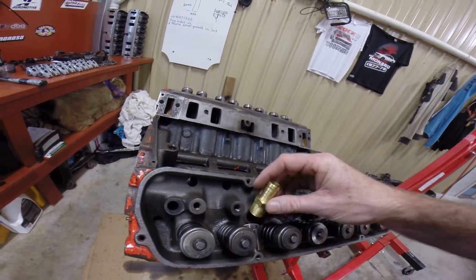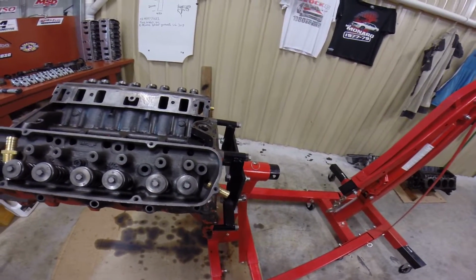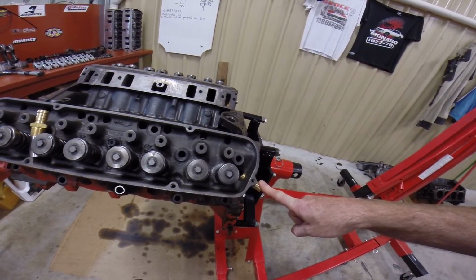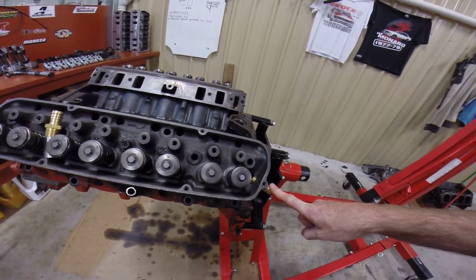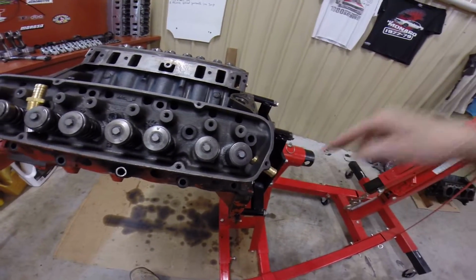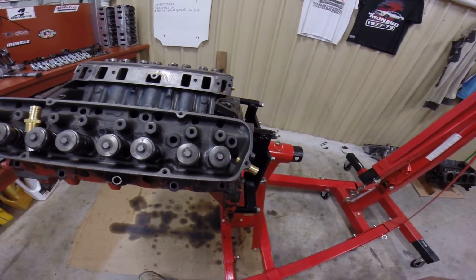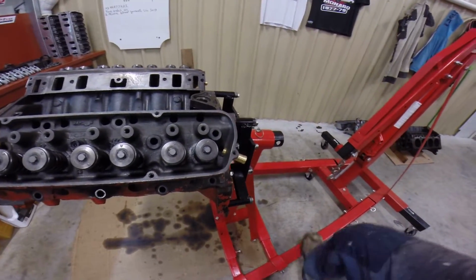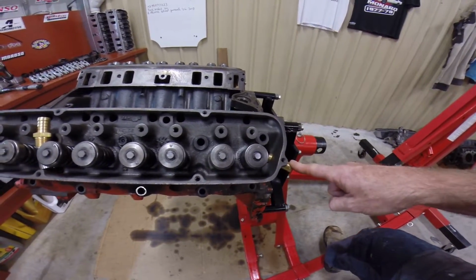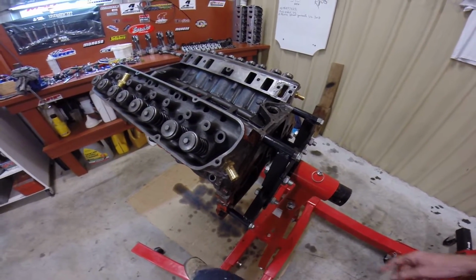Now I was thinking about just doing it gravity style, but I'm not sure if it's actually going to be enough, because if you've got a certain amount of crankcase pressure in the engine, you're not really encouraging the oil to get back into the sump very quickly. I know it'll help, but I'm actually going to do it: I'm going to run a scavenge pump, the same as the one off the turbo.